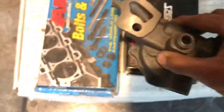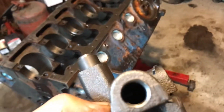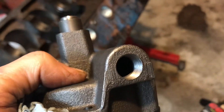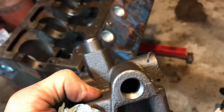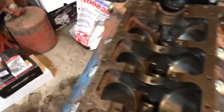The pump — if you look at this pump, you can see this here. I have to take it apart and we'll have to open that up. And then the pickup tube — I might make a 5/8 or 3/4 pickup if I've got enough meat around that to open it up. Because the pickup is really the main thing for these Mopar small blocks. The pickup is the biggest thing — making sure your pickup is big enough and then your pump works to get the flow through it. So anyway, back to work.